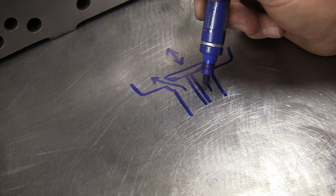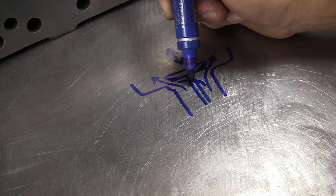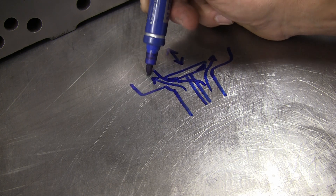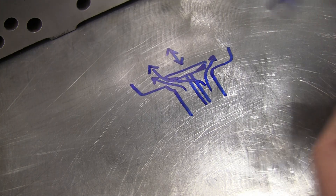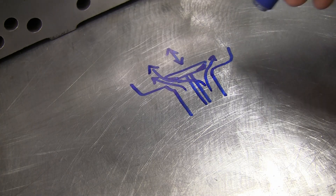The air comes out the port and past the valve and into the chamber, and it just cuts some of the restriction away. It also allows the air, when passing across the back of the valve, not to have as tight a turn to do - it travels across the back of the valve head and it's just got that 30-degree turn and then off the seat. It basically helps to cut that restriction out, so it's a really simple modification. Like I say, it costs virtually nothing and the improvement in airflow is quite decent as we'll see when we test it on the flow bench.